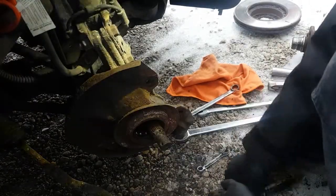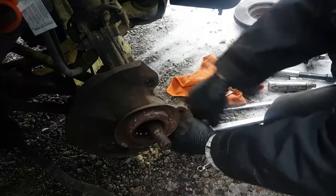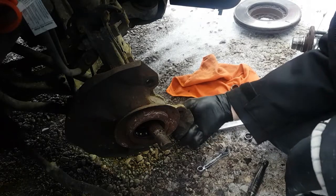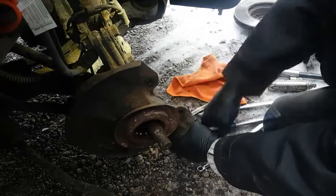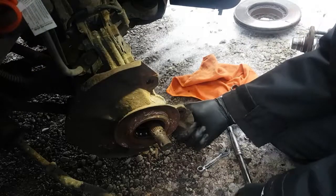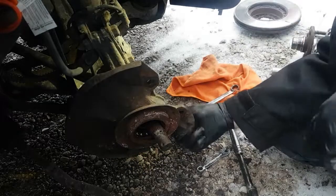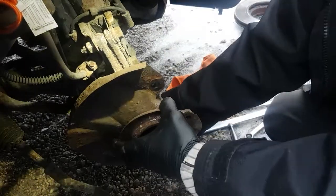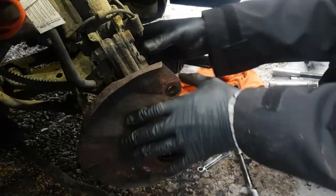And loosen this one down here. So once you get these bolts out, you want to be careful. There's a little bit of tension on the control arm. And it's basically just these rubber bushings trying to push the control arm up. So usually if you just lean on it, it gives you enough to get some space to work. So now we're going to push the CV axle out, and alas, we can do it on the car.